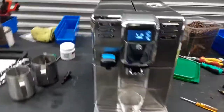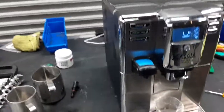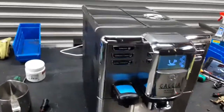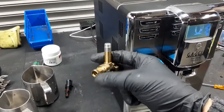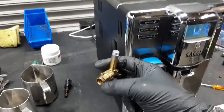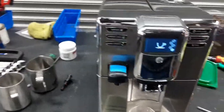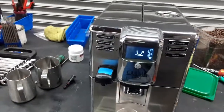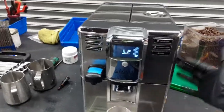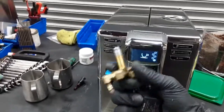This machine was brought here because it was leaking from the bottom and it had other issues with the flow coming out through the spouts. For the leaking at the bottom, we found out that the machine needed a new two-way solenoid valve. This one is supposed to be closed when it's not activated, but it was leaking through here — not fully closed, allowing water flow when it was not supposed to. That was causing the leaking and also some erratic behavior when pressing the espresso button. It would just shoot water through here instead of actually going through the brew unit and through everything inside the machine, so it was definitely interfering with how the machine worked.